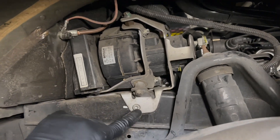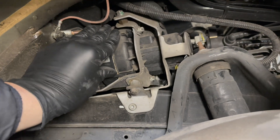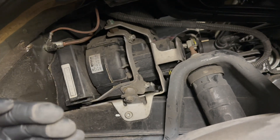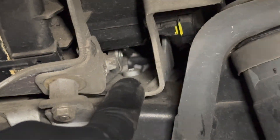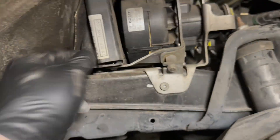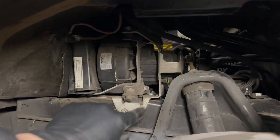Here's the pump — you have a few bolts holding it and it's mounted to a bracket. The easiest way is to unbolt whatever bracket is holding the secondary air pump, pull the entire bracket out after you unplug it, exchange the pump on the bracket outside of the vehicle, and then put the entire assembly back in. I'm going to pull out this bolt — looks like there's another one back there and another one down here. I've never done this particular job so I'll figure it out as I go.